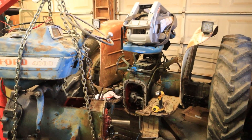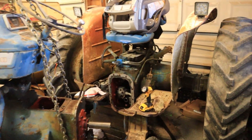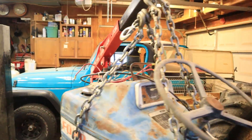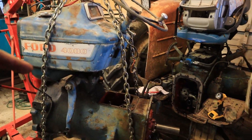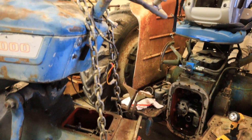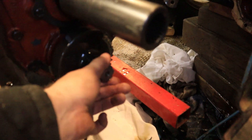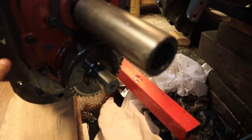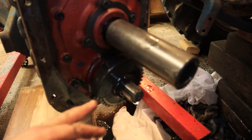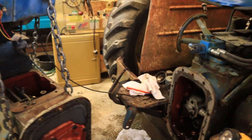We made good progress there, though we did make a bit of a mess. Unfortunately not all of the fluid was drained out of the bottom of the pan, but we'll try to get that cleaner as we go. We have our blocking in the back for the rear end, and the engine hoist was able to pull the transmission and the fuel tank out. I'm not too big of a fan of how it's squeezing the fuel tank, but it's doing the job for now. We need to find a way to pull this shaft towards us a little bit so we can take that front pulley off — there's a snap ring here, so I'll have to look into how this shaft comes forward. Worst case, this whole housing might end up coming off.